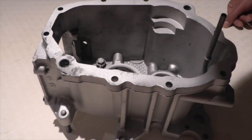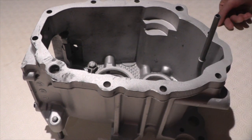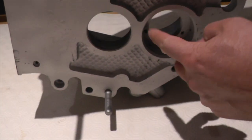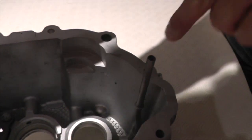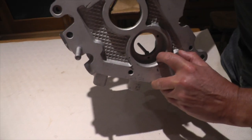A short video about the R380 oil feed ring. This is the rear casting on the back of the R380. The oil pump sits here. The oil is sucked through a filter down this pipe. This is the pump inlet.